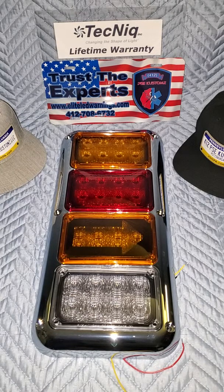That really is the only function of the arrow mask. The turn signals can be ordered in two different formats — they do make them with an internal flasher, for a vehicle that doesn't have an internal electronic relay running the turn signals. In my case, my vehicle does, so this is just a steady burn version. You can order all of these in a clear lens, so if that's the look you're going for, you can purchase all these in a clear lens — looking at the back of the vehicle, all you see is four clear lights.